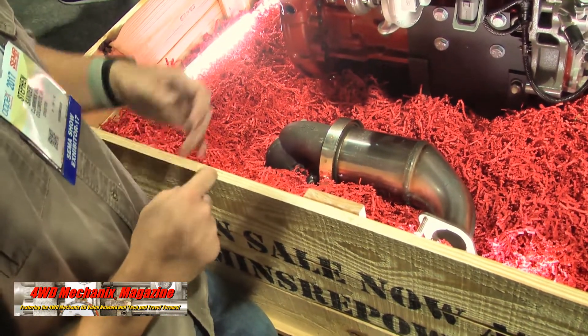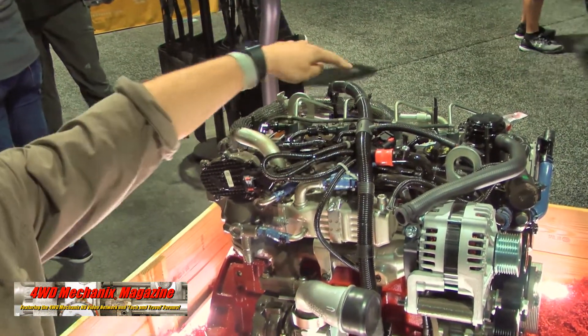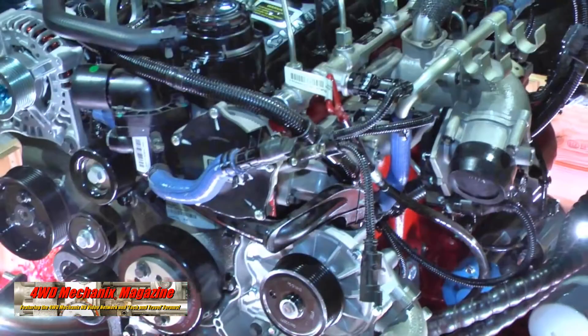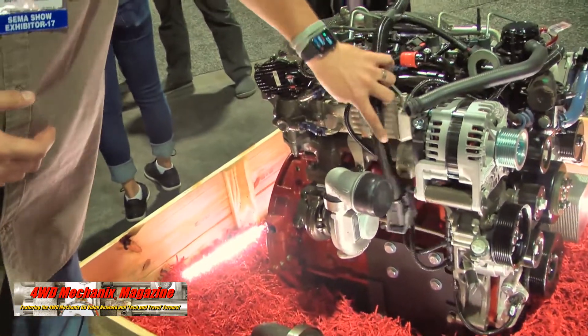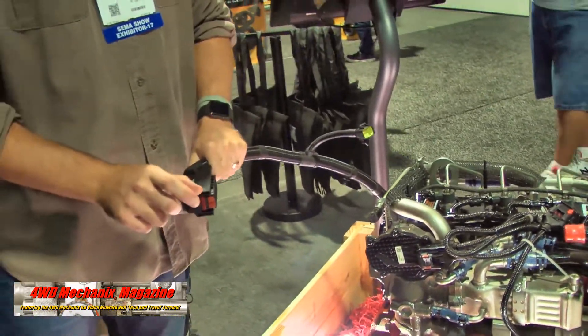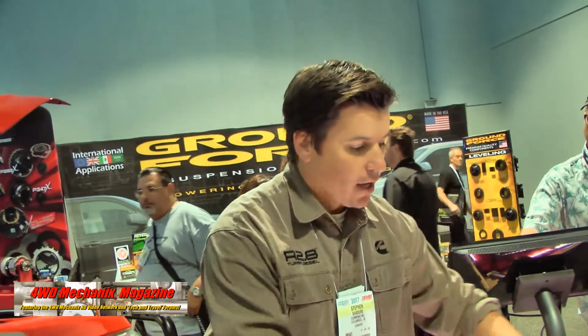In terms of your heater hose connections, we wrapped one of the hard lines all the way back to the back of the engine and left a nice cable stay on that hard line — really trying to include things we learned from the beta and alpha installs. The ECM is connected to this plug here. You've got a nice long lead so you can swing the ECM to driver's side or passenger's side, wherever you want to put it. There's another plug on the ECM for the wiring harness components.